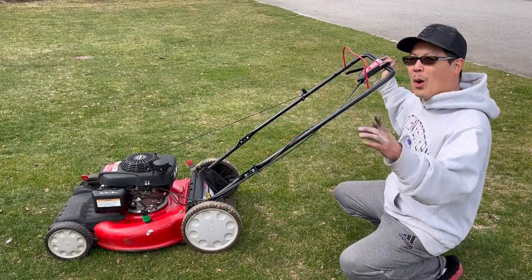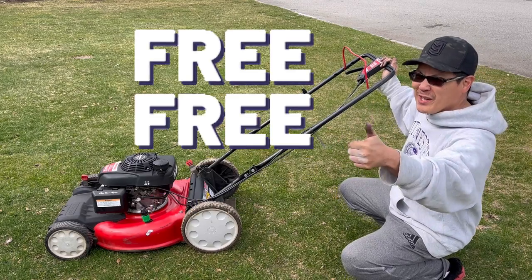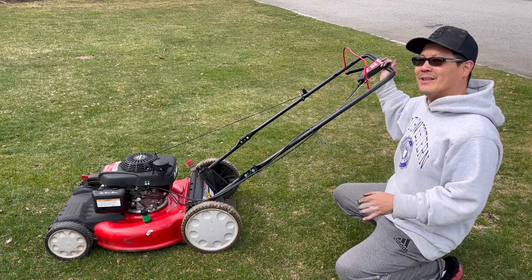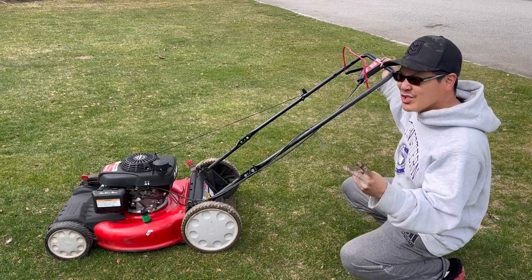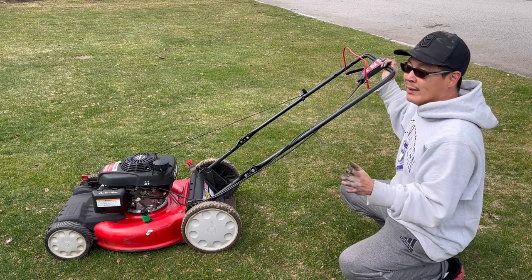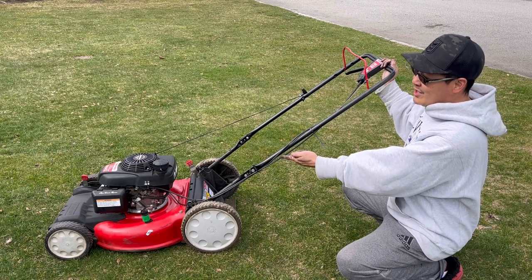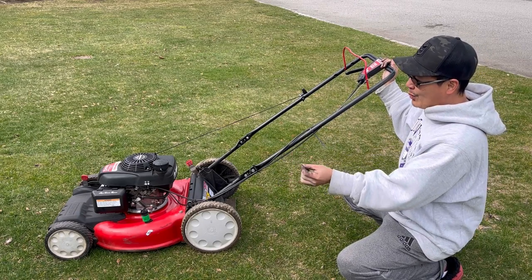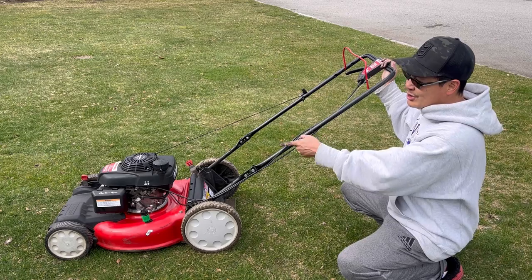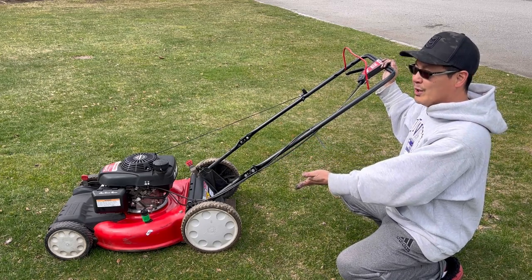So there you go. Picked it up last night with Boba for free. That's right, free. Did a carburetor clean today. Twice. Checked out the wax thing that pushes out the choke thing. Seems to be okay. Did a wipe down with super clean. Changed the fuel line that was cracked and bad. Changed an air filter. Self-propulsion works. Good high wheels.